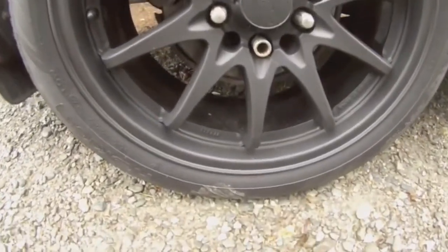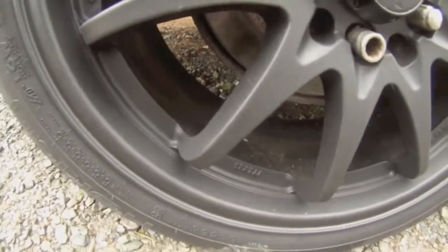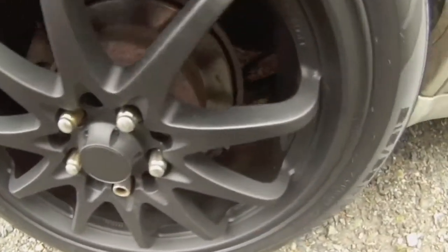It came out pretty good in some spots. Not so good in others, because one thing you need to do is clean the nozzle of the spray can, because it dries, and when you use it again it comes out in clumps, and then you get big thick clumps all over your rims where you shouldn't have them. I fixed that just by putting more layers of paint, but clean your nozzle after every use.